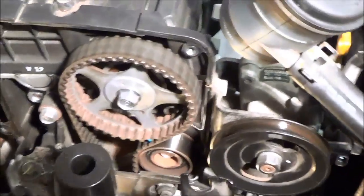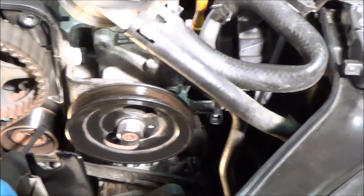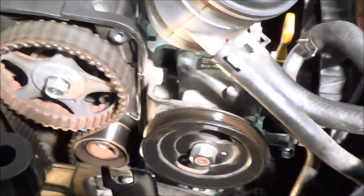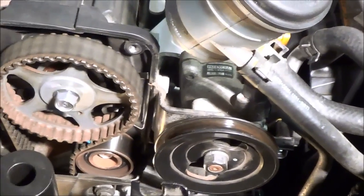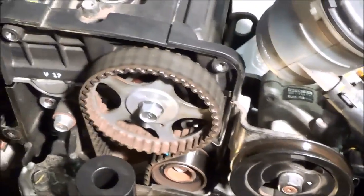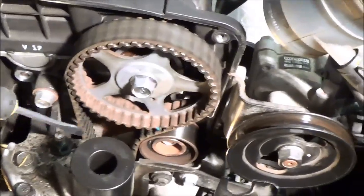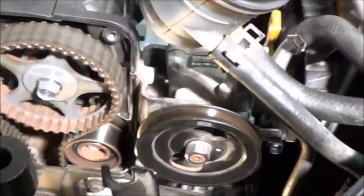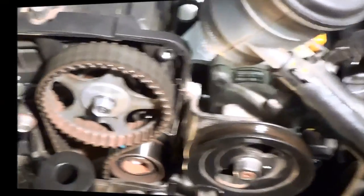The seals aren't leaking today. Right here — that's your idler pulley; we're going to be replacing that today. And below the cover there's a tensioner, which you can't see because we still have to get the lower timing belt cover off. Be very careful when you remove this because the rubber seal is going to stick and it ain't going to come off really easy — you've got to work it off slowly. There are no bolts underneath holding it, just one bolt here, one bolt here which held the engine bracket on, one bolt here, and then there's another bolt down there — that's all that holds the upper timing belt cover.